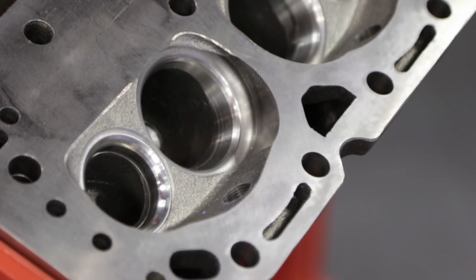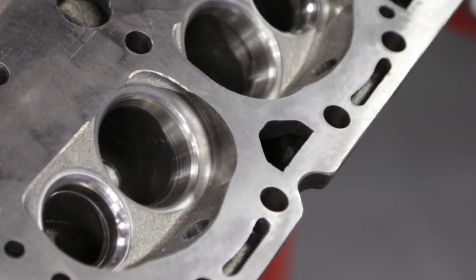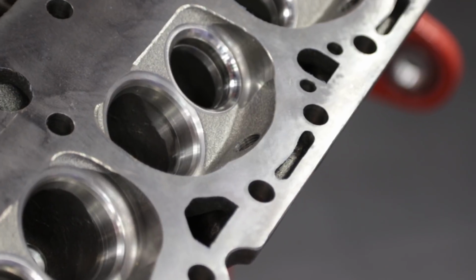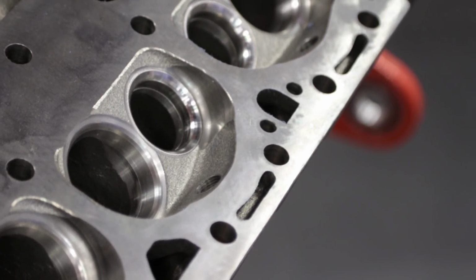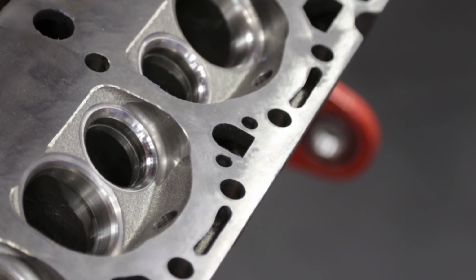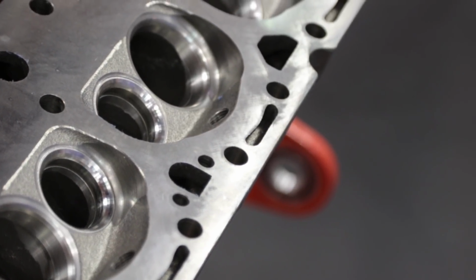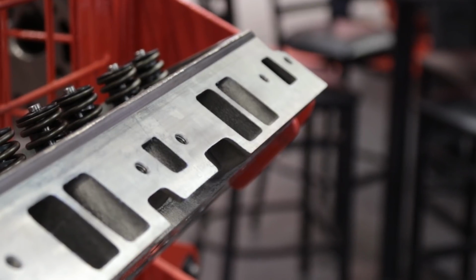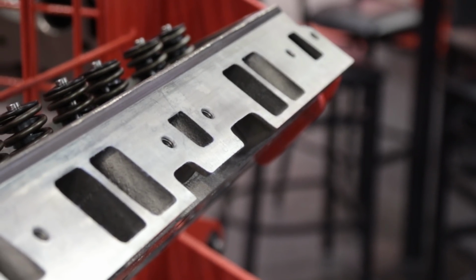The SR Torquer head is a 202 1.6 valve, uses a guide plate instead of a push rod guided head. So for the guy that wants the first step up from the stock head, that would be where he'd go. And then what's after that? I know that I've had a great opportunity to use the Sportsman IIs, but even beyond that, there's a lot of things that set those heads apart when you're talking World products.